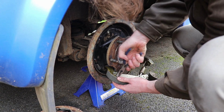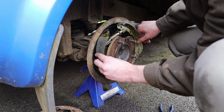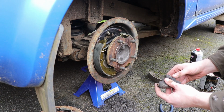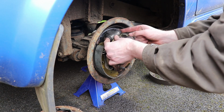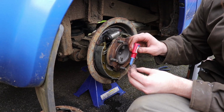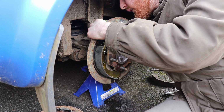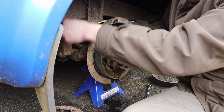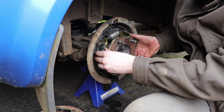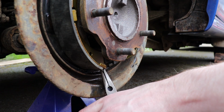Then I hooked the handbrake cable to its plate and awkwardly pushed the brake shoes around until I decided that reinstalling the brake cylinder might be a good idea. With the brake cylinder and necessary brake lines connected, and the bolts that hold everything in place having been administered some Loctite, I then pinched the brake cylinder between the two brake pads and tucked the bottom of the brake shoes behind some sort of tensioning plate, and finally hooked them together with the appropriate spring.